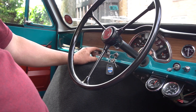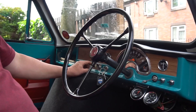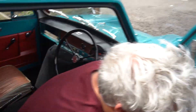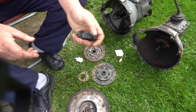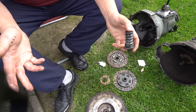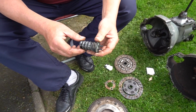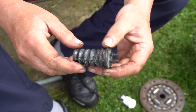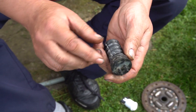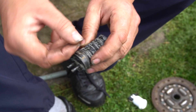I'll show you what I did with the washer. Although it's electric, I wanted to keep the original fitment and convert it. There are various ways — it's not difficult, all you're doing is putting a switch on the back of that button. This will prise out of the back. All you have to do is undo that little screw thing, take your pipes off the back, and the whole unit will come out. These little clips here clip into holes on the cylinder casing — you just prise them out with a screwdriver and then this comes out.